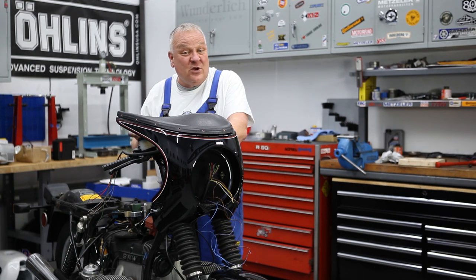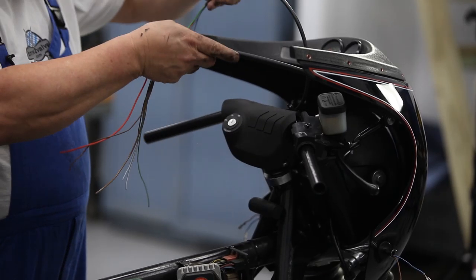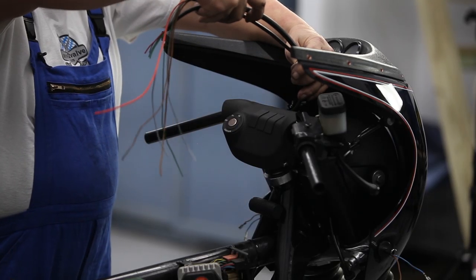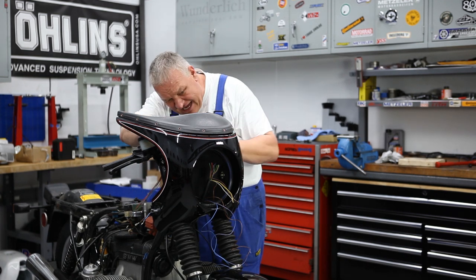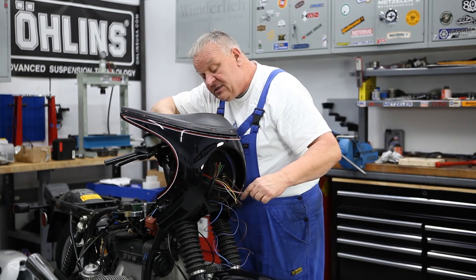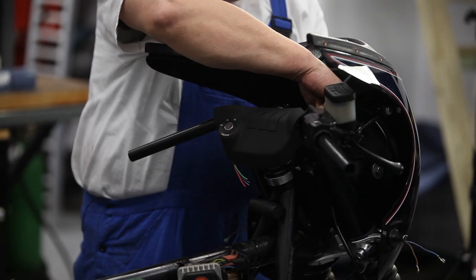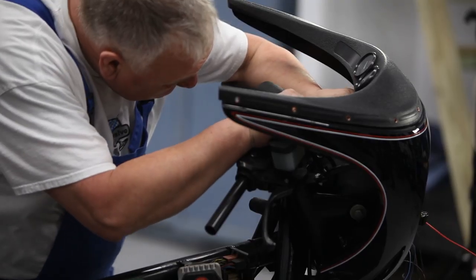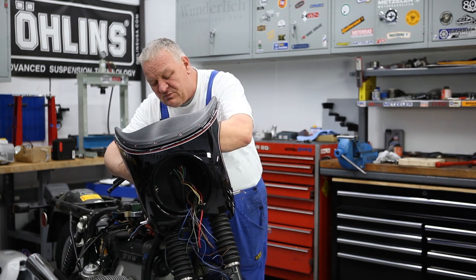There are a lot of ways you could wire one of these things — there's probably someone out there with a better idea, but this is how I'm going to do it. I've got these two harnesses that I need to put through that one grommet that we enlarged. I don't want to drill any more holes in the headlight bucket, so I'm basically going to merge these two into one using a technique very similar to the factory. I'm looking for good routing with nice smooth bends — aesthetics are always important.